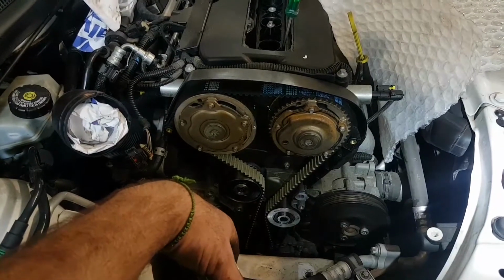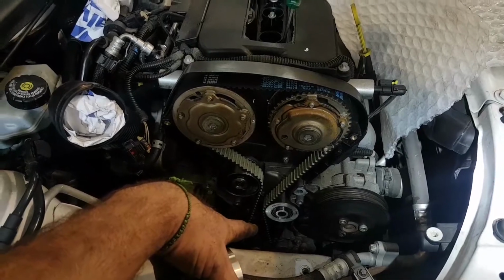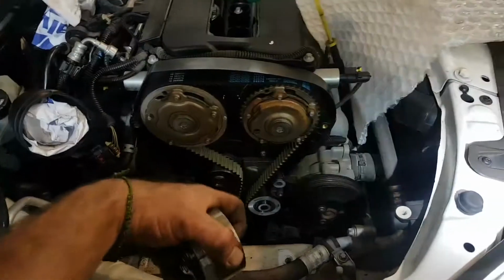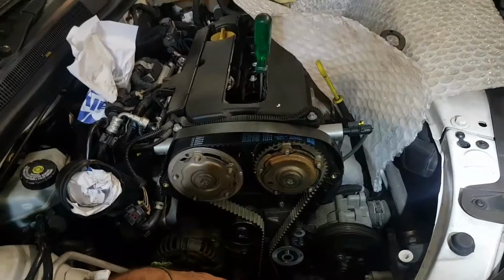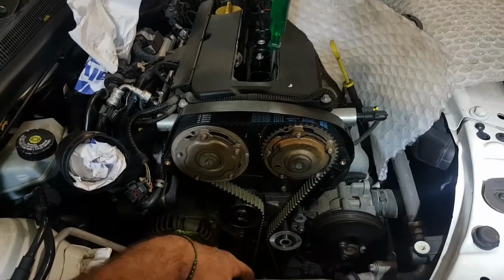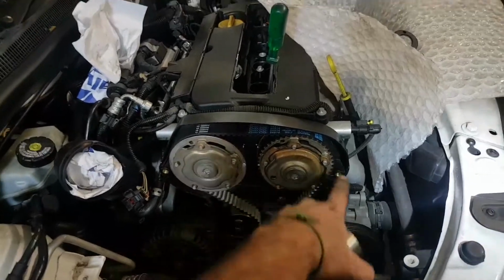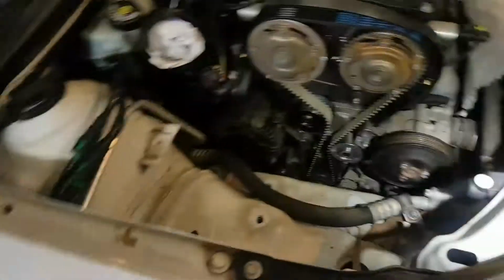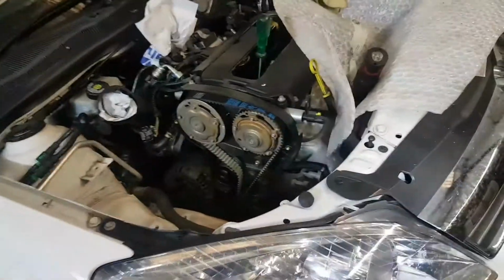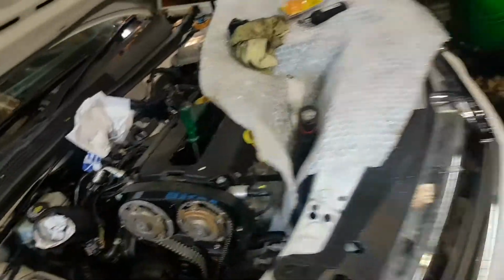Extremely fragile as well. Another note is with the belt tensioner. They do seem to get stuck on these. They don't just fall off like the other ones, so be patient and lubricate it. Some of them are corroded on the back. Otherwise, it's pretty straightforward. But yeah, this is the main point here, is you don't need to have any special tool or whatever, if you use common sense. But if you don't have common sense, then you should have the special tool.